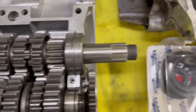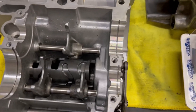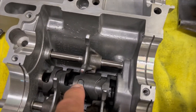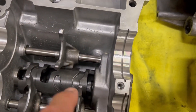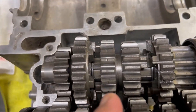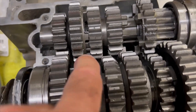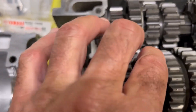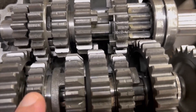Let me lift it up. Down here there's a clip that holds things in place. Let me take the gears out so we can see everything better. This block manipulates the arms back and forth. These are the arms that move your gears in and out — they go in here. This one goes right in here and moves the gears back and forth so it can shift gears. These go in and out.